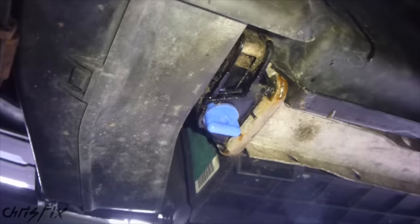Now we'll go under the car and look for the radiator petcock, which is a drain plug for the radiator. Here's one corner of the radiator, there's the other corner. In this case it's on the driver's side corner. The petcocks are almost always located in the corner of the radiator, and this blue thing right here is what needs to get unscrewed, and the coolant will drain out of that.